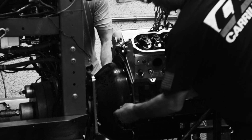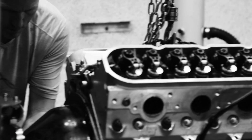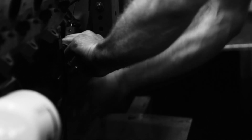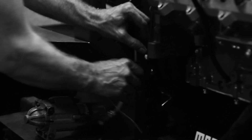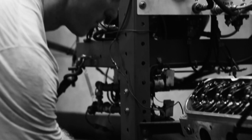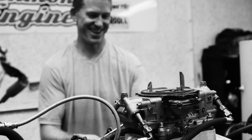We'll put links to previous videos in the notes below. Basically what we did is we took a 6.2 liter block — a core engine out of an old Cadillac Escalade — and fit this block with a 4.8 liter crankshaft. The bore on the 6.2 block starts life at 4.065, and we took it 60 over to 4.125 so that we can use an LS3 piston with the 4.8 crankshaft.